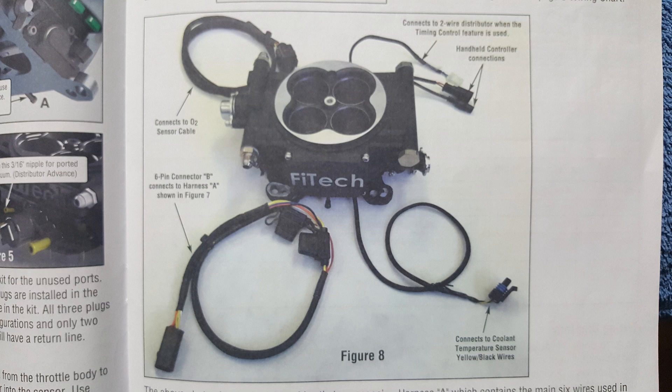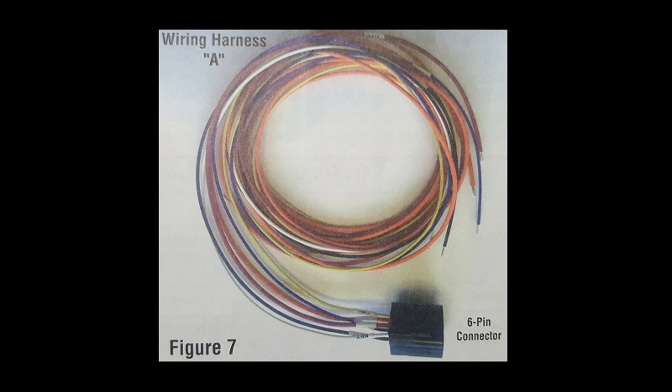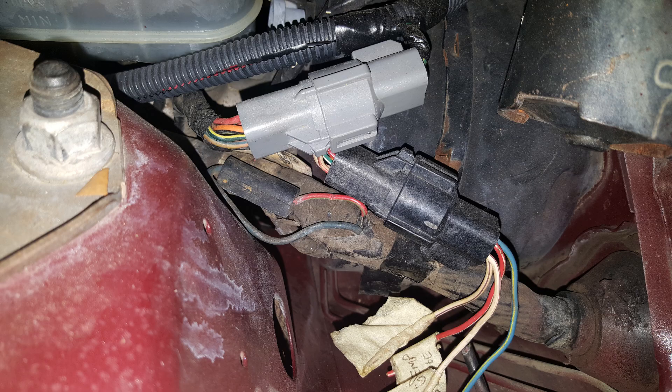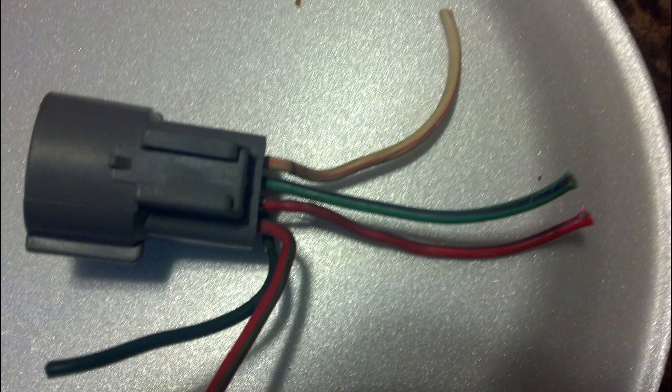Each system will come with a labeled wiring harness and wiring diagram. Each wire is self-explanatory except switch power and the fuel pump relay, and where it will be connected on your Mustang. Behind the driver's side shock tower, you should have two weather pack connectors left over after you remove the EEC-4 wiring harness. Find the corresponding connectors on the EEC-4 wiring harness you removed and cut them off the harness while several inches of wire remain with each connector. If you do not want to damage your original wiring harness, you may be able to get connectors from a third party or source them from a yard.